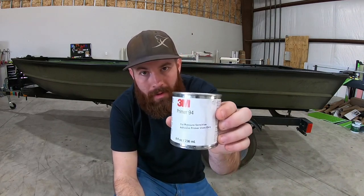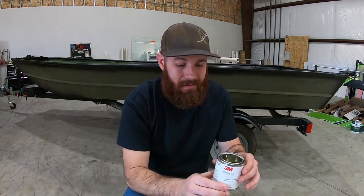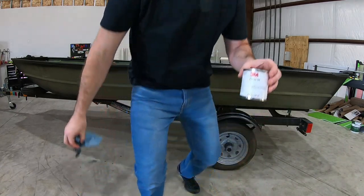Just got the primer all put on there. I put it on really, really thick because I want this wrap to hold, especially since it's going to be completely submerged. Normally on boats you don't want to go below that last little ridgeline — at least that's what 3M says — but it's going to take a pretty hard beating with the water constantly splashing. For a boat you definitely want to use a lot more primer than you would on a car. We're going to let that dry for a couple of minutes. You don't want to put your wrap on while that stuff is wet because it won't activate and your wrap's going to have a filmy, liquidy texture and it won't dry up at all.